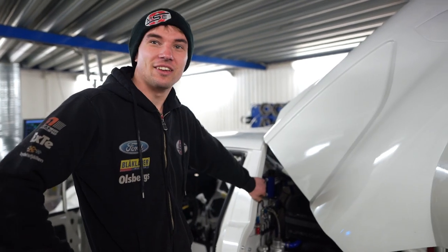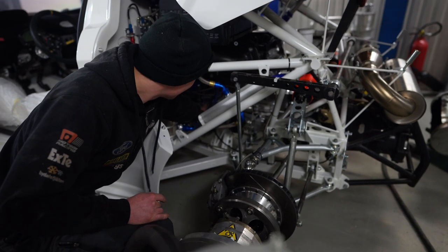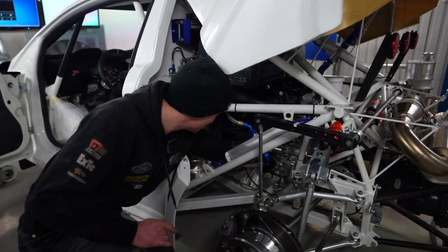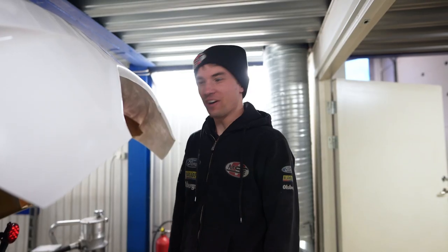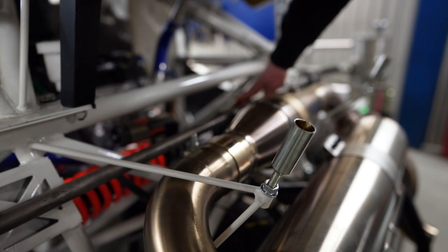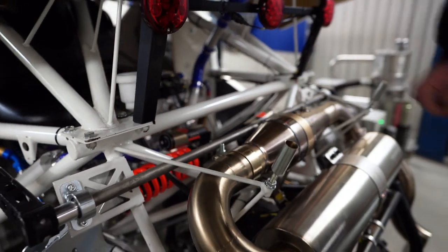This car has the new oil pump update. Before, we used to have the external oil pump sitting here with a belt — belt-driven — but with the new update it's an internal oil pump with a chain. So there's no chance now that you break the belt and lose oil pressure. This is a good safety update. Another update for this year on this car is the new R53 dampers — it's a new model for this year. We've done quite a lot of development work on this one, so it works really nicely and it also looks very good. Let's see if we have any power in these new lights.